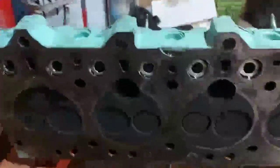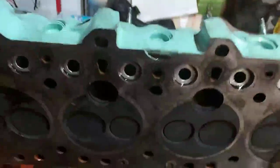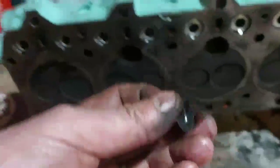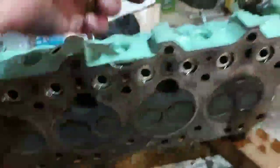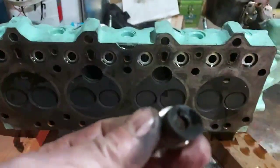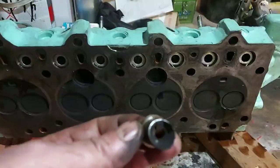30 minutes later — head's off. I've taken the hot spots out and tapped out the injector shrouds. That's all it is — it sits in and goes in from the injector side. I'll show you how I got them out in a minute. I'm going to change all of them now that I've got it in bits, so I'm just going to change the lot.